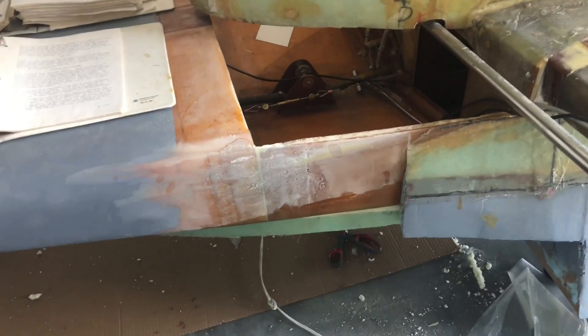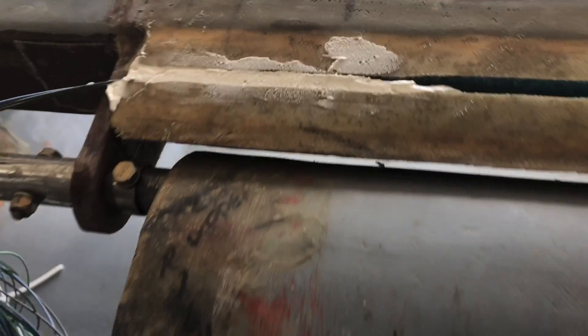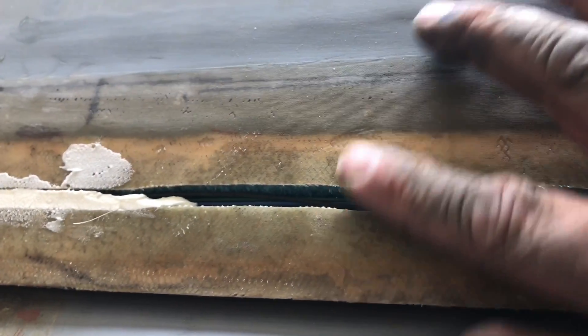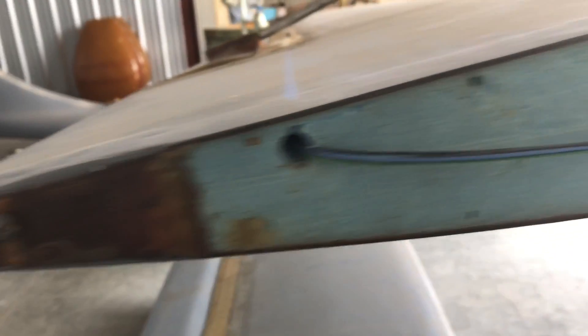This is the side down where we just connected that. We've been working on the landing gear - notice we've got all of our hydraulic tubes in. We've got this one coming up and running across and down to our junction T over there. We're short three pieces to finish tying that system in. We had to make a slot through this micro fillet right here in the foam to get the wires in, because there were no wires going out to the wing for lights. So now we've got them coming out right here.